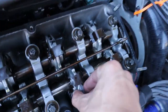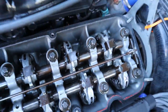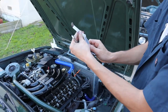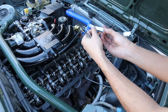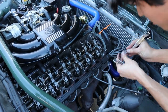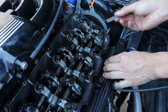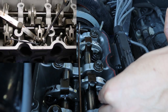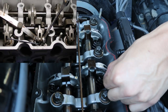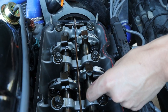Now that this one is on that section of the cam where it has that ticky movement, I can go ahead and do that procedure. Take our adjustment — 0.010, right? 0.010 inches, 0.254 millimeters. Got our thing here. I'm going to feed it right in this gap, right in there. As you can see, I'm having a hard time moving it through here. Honestly, this is a little too tight, so I'm going to loosen it a little bit.